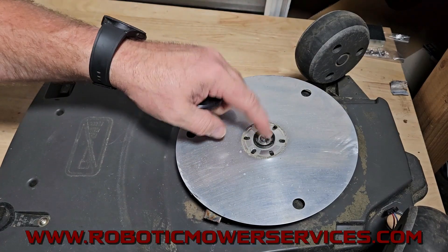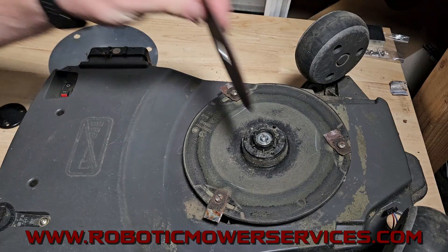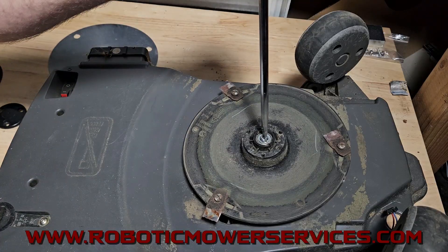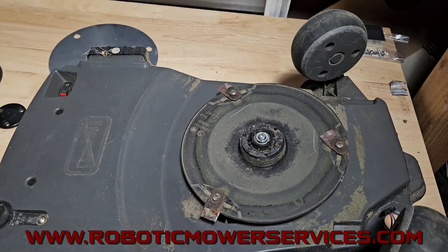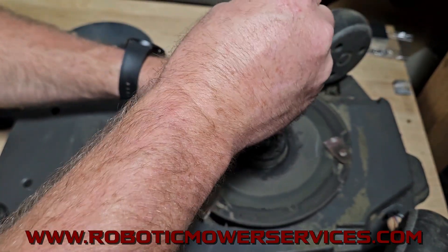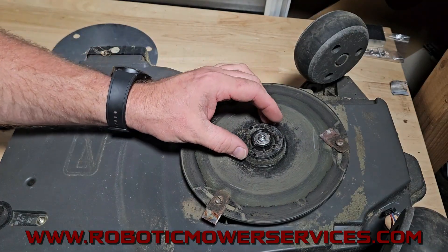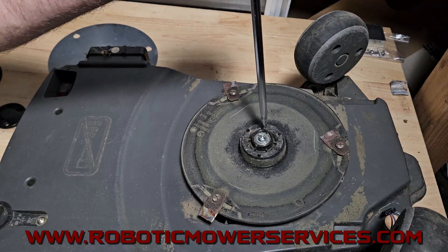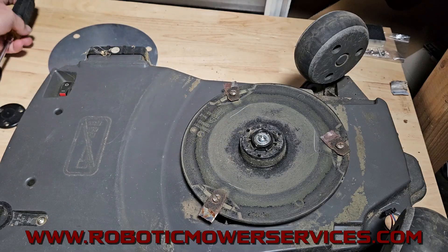So that's it. If you have that screw stuck, that's the easy way to do it. Remove all this stuff, get down to it, take a grinder, cut a slit in there — just go down to just barely reaching the flange — then use a straight screwdriver instead of an allen wrench and turn it right out. Worst case if that doesn't work, you can line it up 90 degrees from where you already cut and put another slot through there so you can get a Phillips head in there if need be. But usually the flathead screwdriver works just fine.